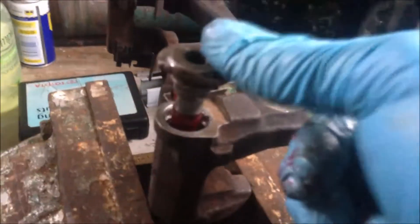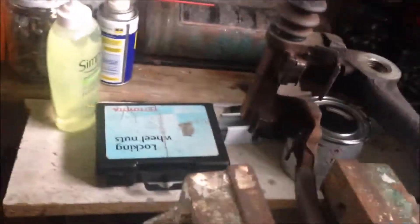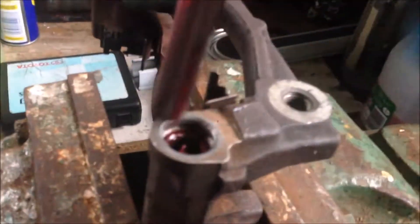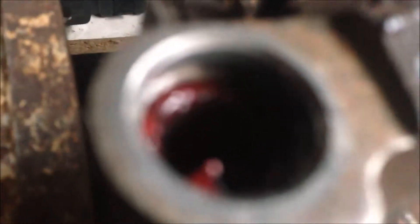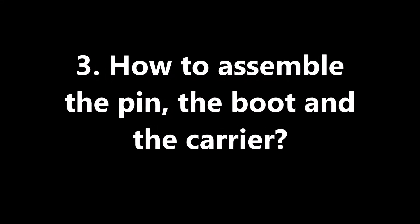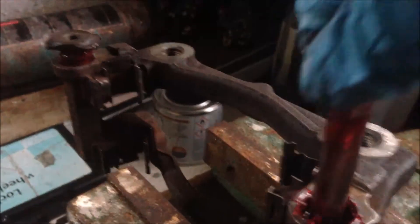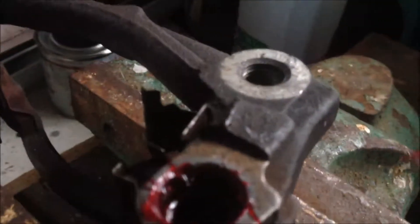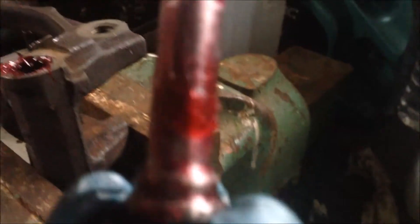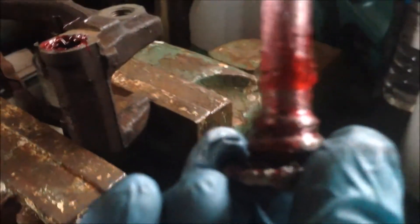Air is rotating — you can see the air in it. By this way, I can get a layer of rubber grease into the hole, you can see. So I have put the grease on the pin into the hole, and at the groove of the rubber boots, and at the bottom of this pin, so everywhere we have got grease.